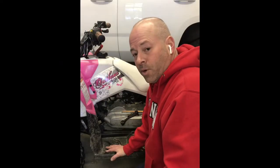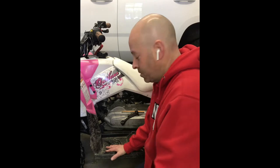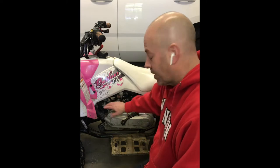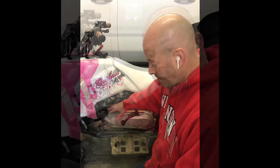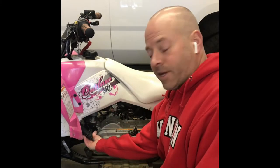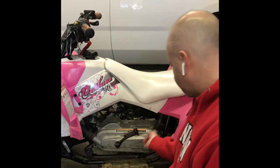After removing four bolts and six Phillips head screws, I can now take this piece of trim off. I'm going to clean everything up while I'm taking it apart to get some of this dirt and mud off. Now I've got to take off this cover plate, and that is going to be an eight millimeter socket. Don't forget there are some hose clamps — these are held on, just crimped, with a Phillips screwdriver. You're going to have to take those off as well.